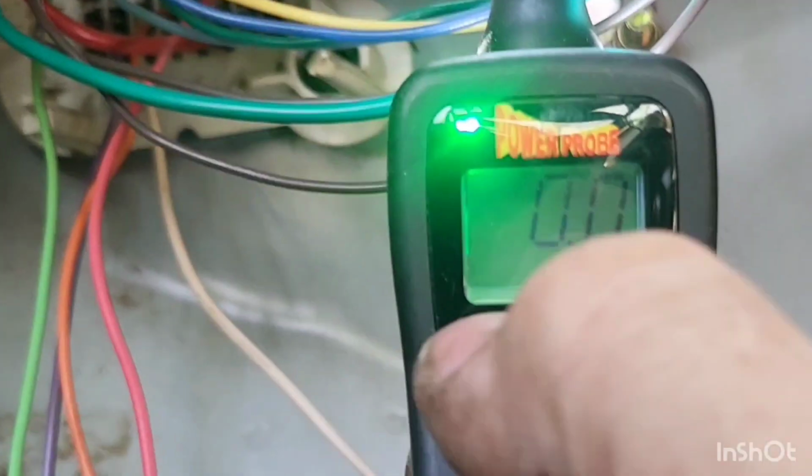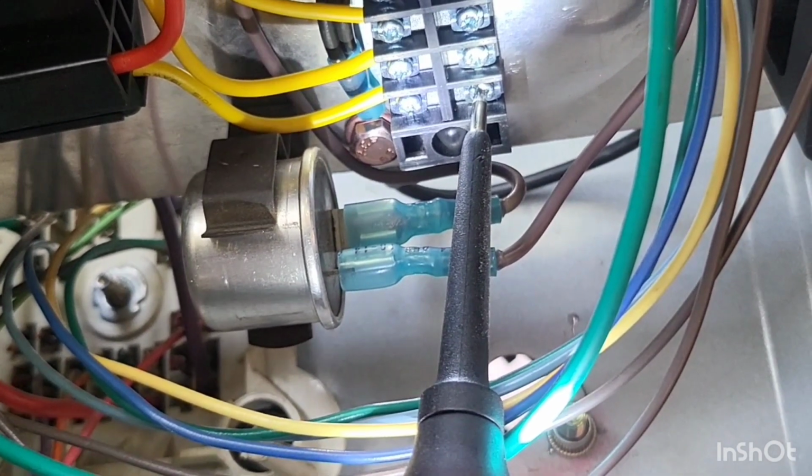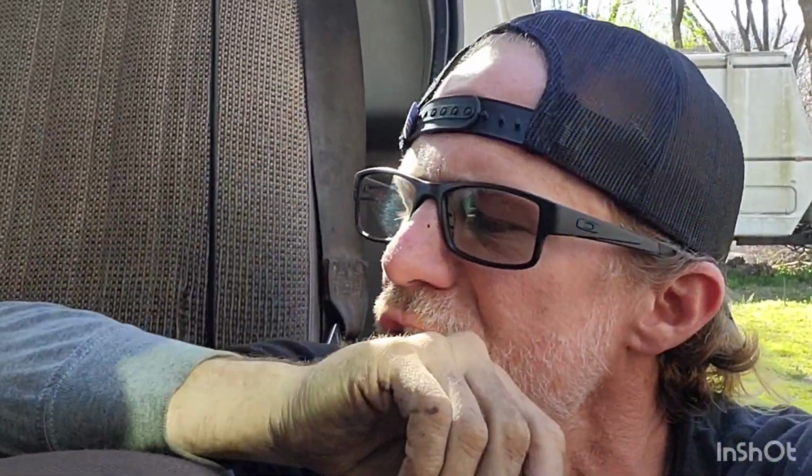Now, I know I explained it while we were on the table, but I want to goof off a little bit here. So black wire, that's our horn relay, and it's triggered by a ground. So horn works. Right and left blinkers are right here. You can hear the flasher flashing. There's right. There's left. Then if we turn the power off, I can power it up. There's nothing. So, all that is pretty much set up. Like I said, it just needs the switch wires from our new switch that I'll be installing in the dash.